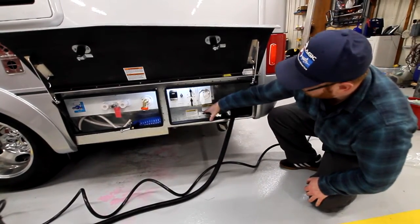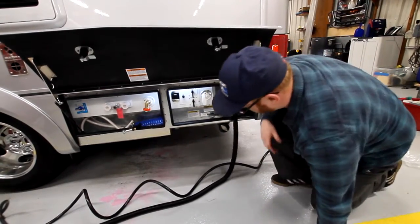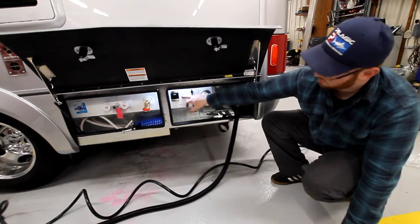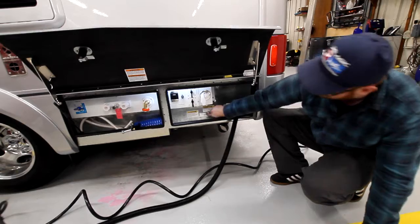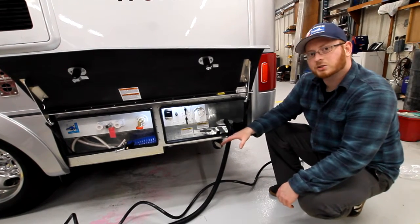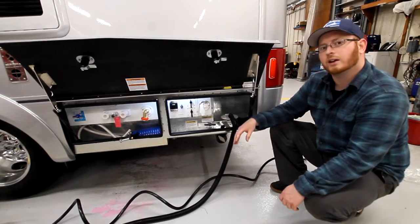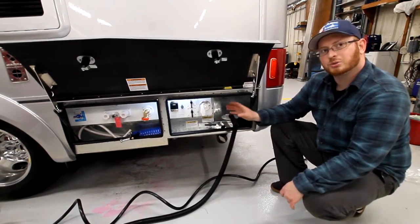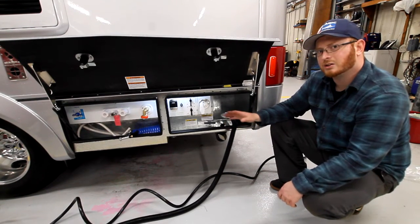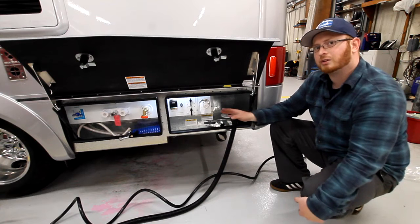Once that's done, go ahead and pull on the gray tank dump. That's going to be all the water from your shower, kitchen sink, and bathroom sink. Now there's a misconception that you want to leave your valves open so it drains right away. That's not the case — these units have a holding tank and they don't drain out right away. What helps keep them going is you want to use a lot of water inside. You can pre-dump some water in your toilet to help keep your solids floating and your paper from matting the bottom of your tank. If you just let it go, it's going to stack up and become near impossible to get out without replacing the whole tank, which is very costly.